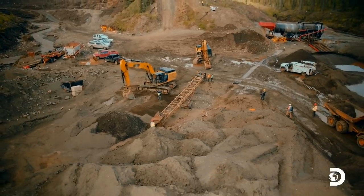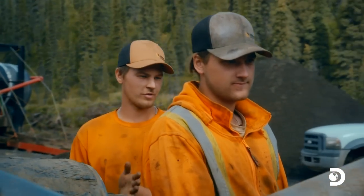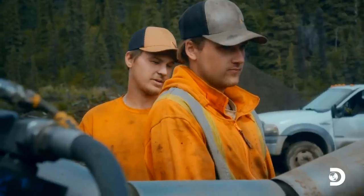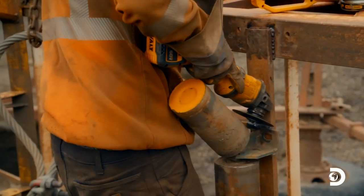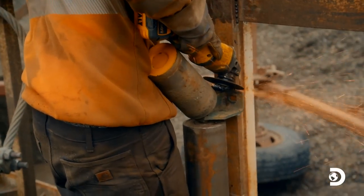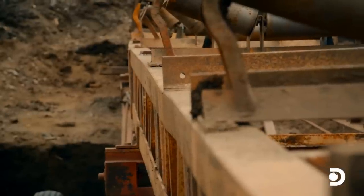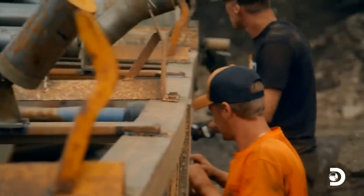I think what you do — where it just starts to bend, you cut it there, you pull this whole thing over, then you weld it when that's straight, then you move over to the next piece, you bend that into place, you weld that. Brendan's fix: cut the crooked section of the frame to weaken it, making it easier to bend, then pull it back straight before welding it back together.